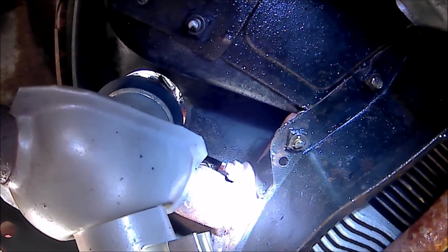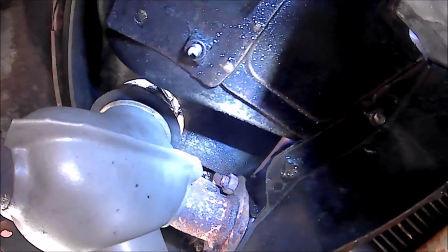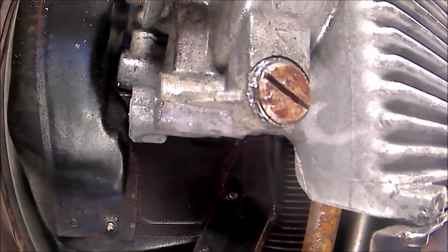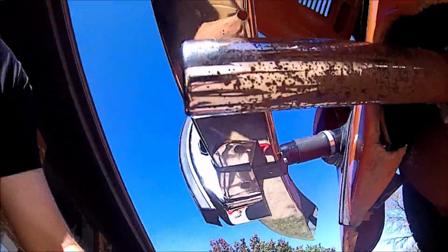And of course, up on top, on the other side of the tin, that's where the heat risers are bolted onto the exhaust as well. So we've just got to undo all those things on both sides, all the clamps connecting the tailpipes if you have to, and then to the heater box, to the head, and then the heat risers.